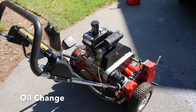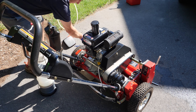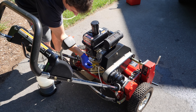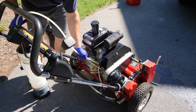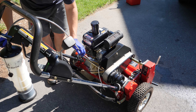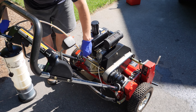The next thing I'm going to do is change the oil. Normally you want to change oil when the engine is warm and the oil can flow out freely, but this is an old machine that hasn't been used in a while. So I want to actually drain the oil out without starting the engine. I can use the drain bolt in the front, but usually those make a mess on machines like this. So I'm going to use a vacuum pump — it keeps the mess down and it's very quick. I'm going to open up the filler and use the vacuum pump to draw all the old oil out. By pumping down I actually create a vacuum and the oil is already going into the reservoir. If you're interested in the vacuum pump, watch my other video on changing lawnmower oil. It's such a quick process — it really makes a big difference.